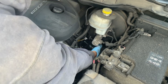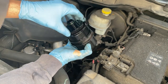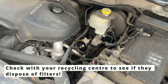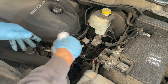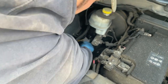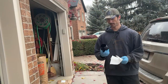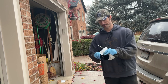As you can see, the filter is attached to the cap right here — it just snaps off. There you go, snaps in the bottom. You can throw the old filter out now. Next, just grab some paper towels or a shop rag and give it a quick clean in the housing to get most of that old oil out. It shouldn't be much; it'll drain down on its own, but just get what's left at the top. Then give the cap a quick clean and clean the threads so no dirty contaminants get in there.